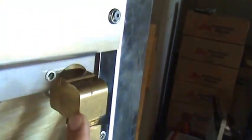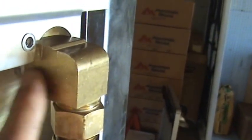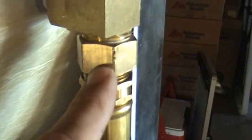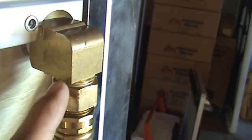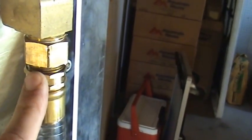What I've done is I just put a 90-degree elbow that I got from a hydraulic shop — basically standard pipe thread. This part here was on there originally; I took that off and then installed this between the two parts. I used Teflon tape for the joints. This is a vacuum line, and you probably ought to use the tape instead of the goo, and only put Teflon tape here and here. You don't want to put it on that fitting — that's got a rubber gasket in it, you don't need Teflon tape on that fitting.